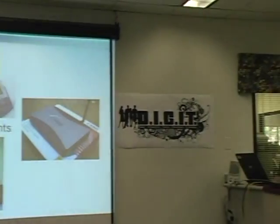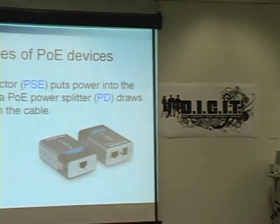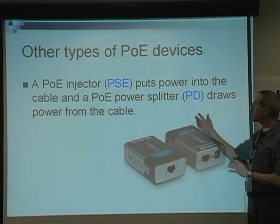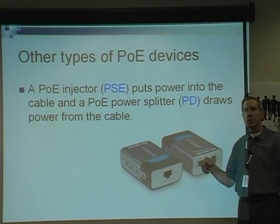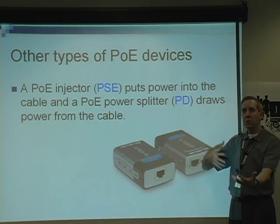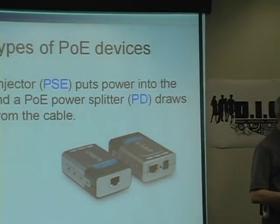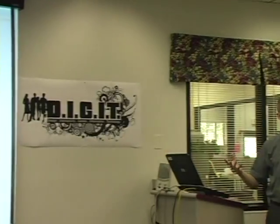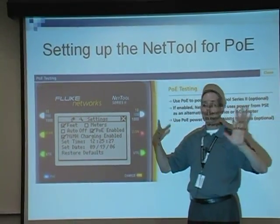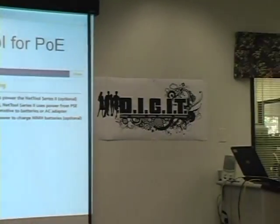Right now these are the big PoE devices. Here are some cool things from D-Link: if you have old switches and you're going to be buying PD devices like an access point or IP phone, you can buy power injectors so that you can mix old technology with new technology. If you don't have the newest power over Ethernet switches, you still can use PoE devices. You do need to remember: on the tool, if you're going to have a campus with power over Ethernet, you need to go into the settings of the tool and enable it, otherwise it ignores power over Ethernet.